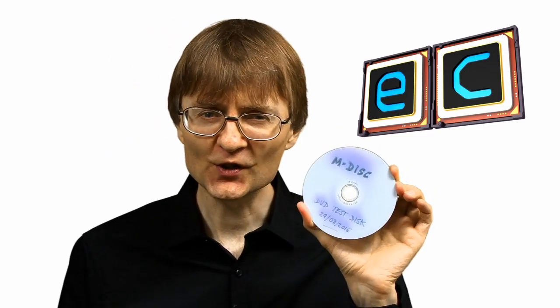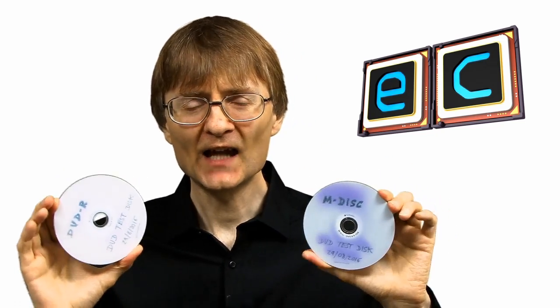That was two days ago. Now it's 11 days since the final freezing test, and the disc has had more time to dry out. The traditional media now looks more like it's supposed to, and both discs now verify fine. What have we learned? If you write with a Sharpie on the inkjet printable surface, it comes off if you store your discs in water. We've also learned that if you have DVD discs which have been water damaged and you think the data's all gone, it's worth waiting several days to see if it comes back. In terms of M-Disc, we have proved that an M-Disc is more robust than traditional media. Yes, the data came back on the traditional disc, but I don't think I'd trust it over time — having seen that colour pattern change, it's not a media I'd want to use for important purposes. I was quite shocked by the change on the surface of that disc. We've seen that M-Disc does seem to be more robust for archival media storage.